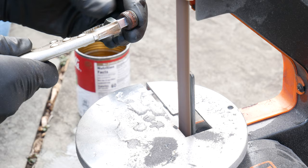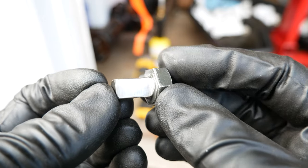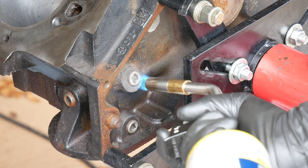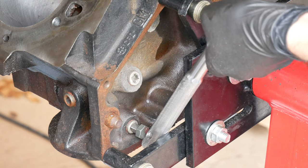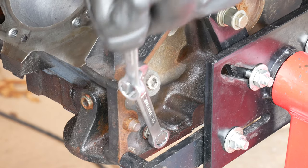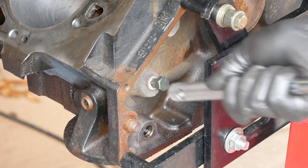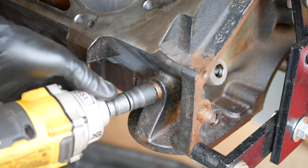It took around 10 minutes of sanding but we were getting pretty close. This time instead of measuring I was just checking the fit against one of the plugs we already removed from the oil filter adapter, and once it was a nice snug fit our tool was ready to go. Here is our version 2 square drive to hex adapter. Those plugs were still really tight so we break out the torch once again before we try to loosen them. Then we install our tool — it was definitely a tight fit requiring a little bit of pressing — and apply force. And more force. And a bit more force. And finally it came loose. We'll unthread that the rest of the way, and then celebrate by hammering it into the other plug. I was feeling confident so this one got the impact treatment and that did the trick. We get to do that one more time for the plug right above the oil filter boss.